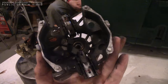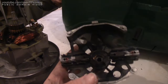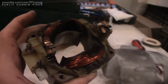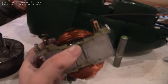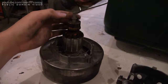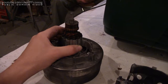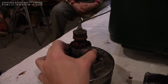Immediately when we take this off, it's entirely covered in soot and just brush residue, as is everything else. The rotor is just entirely black and horrid, except you can see on the stator there — it's an absolute mirror finish — where the rotor has been rubbing against this stator coil pack, whatever you want to call it. And if we then have a feel of the actual rotor, there is giant play in the front bearing. That would probably be somewhat acceptable, but I think this is a bit excessive. It's just a bushing, probably.